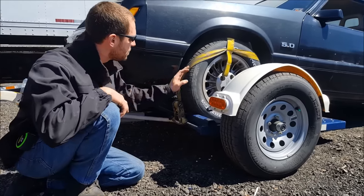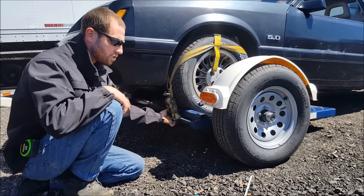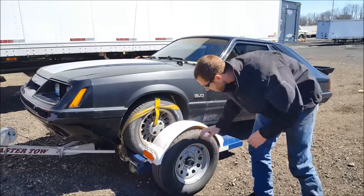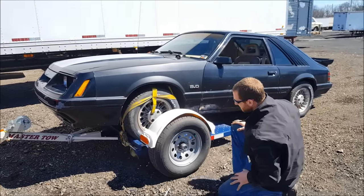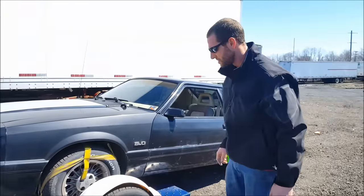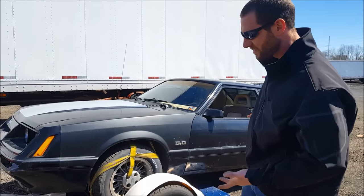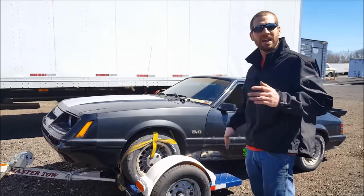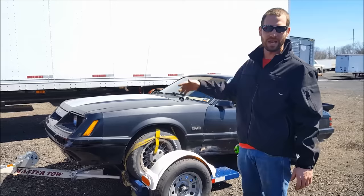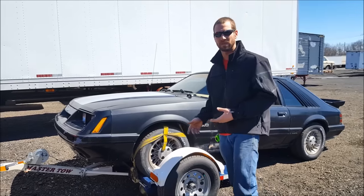Some safety tips: every time you use this thing, make sure you have no fraying or problems on these straps. Make sure the ratchets — keep these lubricated. Definitely a good idea to, once in a while, take a look at your tires, check for dry rot, shake them, check the wheel bearings — make sure they're nice and tight. You have a greasable Zerk here for the wheel bearings as well. Make sure your lug nuts are tight. As for tire pressure, I usually keep this for lighter vehicles around 35 all the time — not too bad when it's empty. But if you leave it at 50 PSI and it's empty, this thing goes airborne like crazy. If you're putting a full-size truck or something heavy on here though, you're definitely going to have to bump this up to 50 PSI.